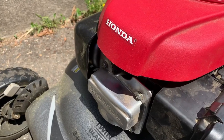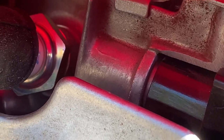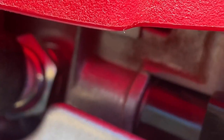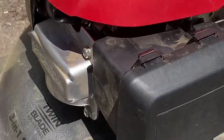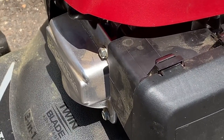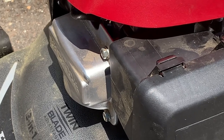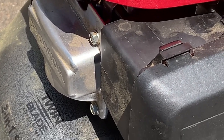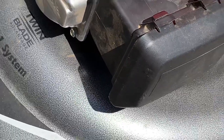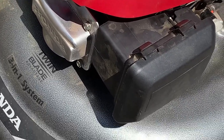I'm saying to myself, what happens in that kind of time? Well, this is one of those Hondas that has, in that housing, one of the wax chokes. It's got the wax with the pin, and that pin pushes the linkage and opens the butterfly. What was happening is the carburetor was clogged. While the choke was on and that wax was cool, it kept the choke closed, feeding fuel through the other circuits — running fine because it was on choke. Once that wax choke opened up, there was too much air and not enough fuel going through the jet. I took the carb apart and found a small clog in the primary jet. I cleared that off, cleared out the emulsion tube, put it back together, and now she ran great.